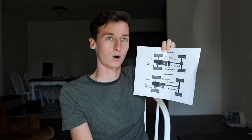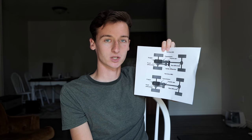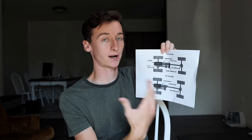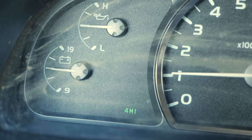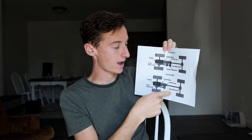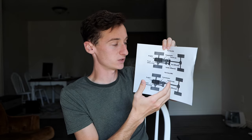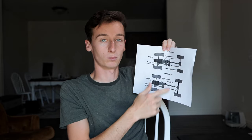This mode is really ideal for driving on snowy roads where you need additional traction but are still on pavement and need to allow some slip between the front and rear axle to make corners smoothly, without putting strain on your drivetrain. If you need more traction than this provides, you can press the center differential lock button, which locks the center differential and causes the transfer case to split power evenly between the rear and front axle — just like a traditional part-time four-wheel drive system. With the center differential locked, the two systems perform basically exactly the same.